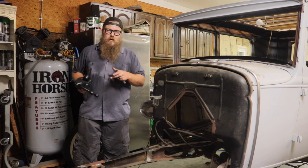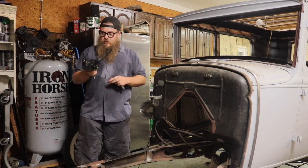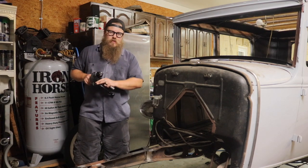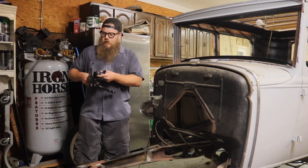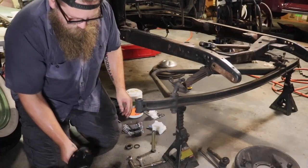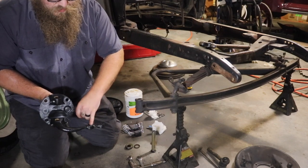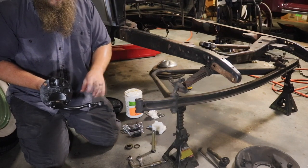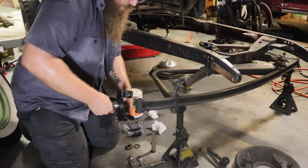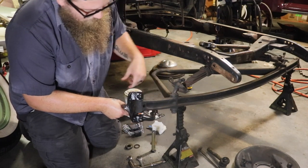Now I'm going to show you how easy it is to replace the hub that holds mechanical brakes for a hub that holds hydraulic brakes. This is my '39 spindle — it goes on just about the same way except it's going to have spindle bearings to help keep the weight off of metal on metal, giving it little roller bearings to help turn a little bit easier. Now on the '39, they are side specific — this side with the double is passenger side, the one with the single is the driver side because it's a push from the box. This is going to slide on here pretty easy. The weight of the car is going to go on the bearing, so when this pushes up you want it to be pushing against the bearing.